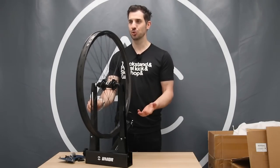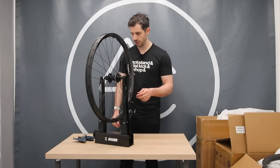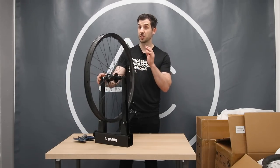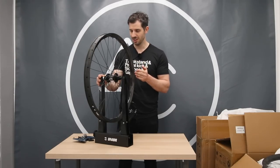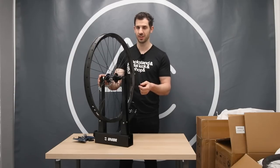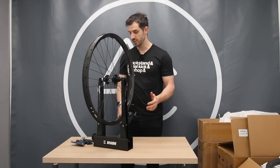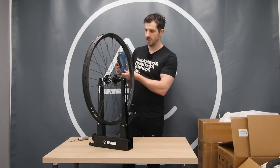Again, how are they getting straighter the bigger they're getting? Whoever's building these wheels at Light Bicycle is doing a pretty damn good job. Let's flip this over and see how the dish is. If I'm being super picky it's probably about half a mil over one direction, but that's well within reason for me — I've run my own wheels way further out than that, so I find that very acceptable. Still very straight. How are the spoke tensions? Let's get the meter out and have a look.